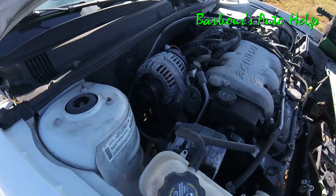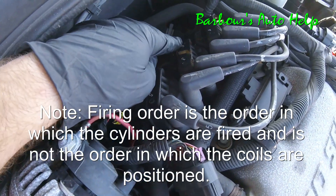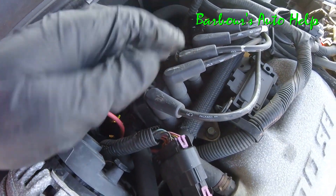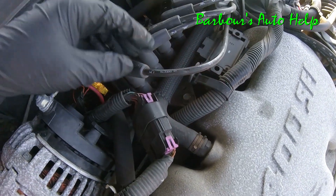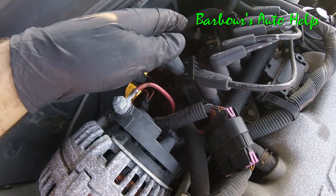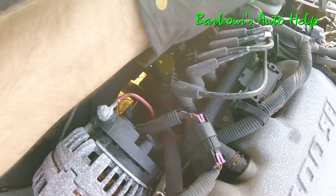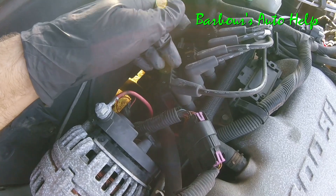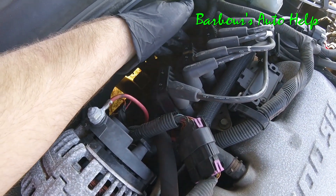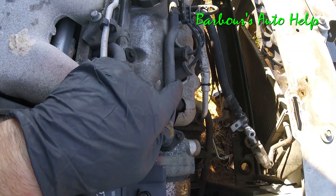If you come over here, you'll notice on your ignition coils on the top of the motor, they have numbers on them. Those numbers identify which cylinder each tower of those coils fires. You can see your wires are numbered. Your new wires won't be numbered. However, when you put your new wires on, all you have to do is find the number on the coil and take your wire and make sure it's routed back to the right cylinder. In this case, cylinder number 5 would be the rearmost cylinder on the back side of the head or the engine. And number 2 would be the one closest to the front of the engine.